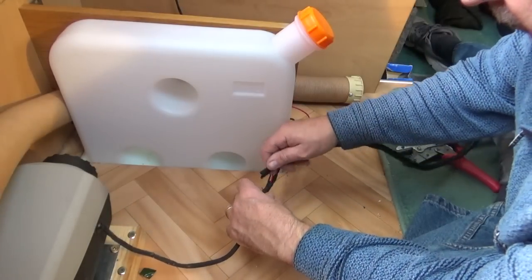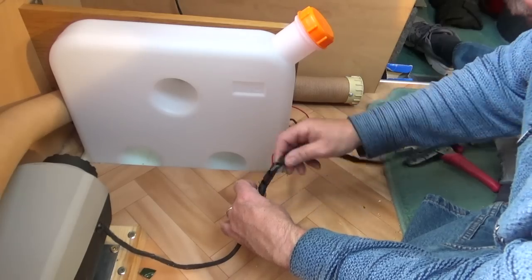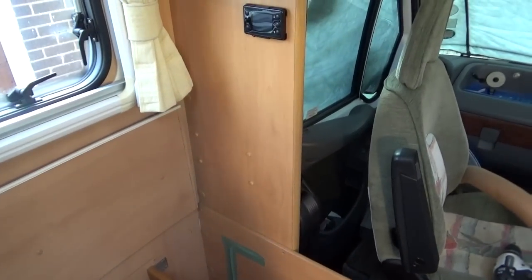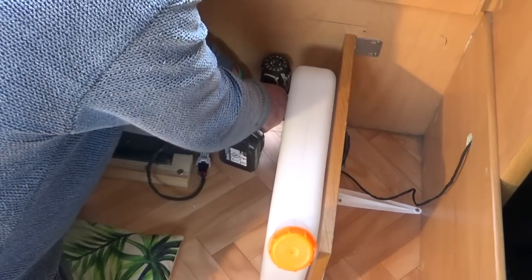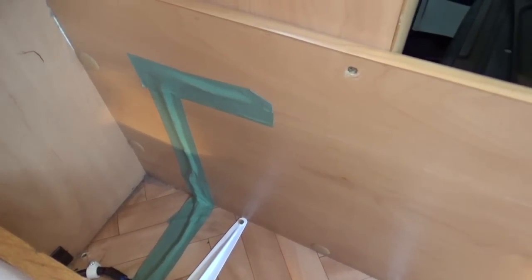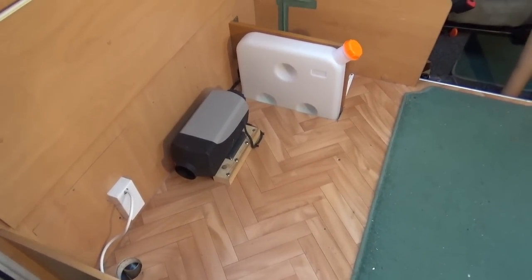The live and the earth come as separate cables but still connected to the loom, and I've joined them to my feed via some straight-through connectors and added some wrap-around cable ties. I've run them through to the loom and across to the burner unit. The cables from the display — I found the best way to keep them in place was just to duct-tape them rather than try and pin them. I've just got to put the framework back, do the ducting, and then I think I can fire it up.